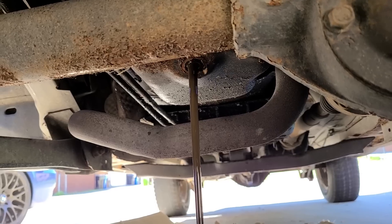This is the cheapo tool I made. It's just a piece of fuel hose that I poked a hole into and ran the little straw from the gum-out can right into it with a little bit of super glue, so this is sealed. We're going to be building pressure in this hose, and both ends of the hose are going to have a Jeep fuel injector. I clamped one end because they will pop off if you hold that can down too long — it builds quite a bit of pressure.